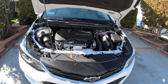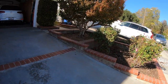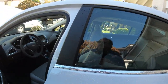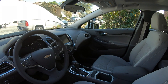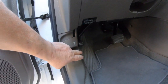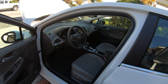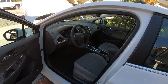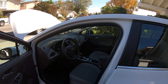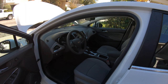If I decide to add navigation, there is an IO6 module that resides on the passenger side right on the kick panel. You just replace that module — plug and play — and you have to add a GPS antenna. I don't know if it's worth it though; it's $1,000. The only time you'd ever need it is if you didn't have a signal to your cell phone, so CarPlay or Android Auto would not operate. Other than that, it's completely useless.